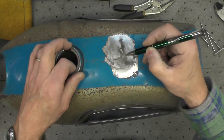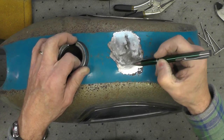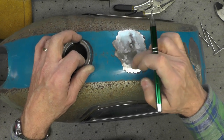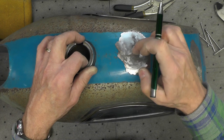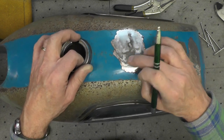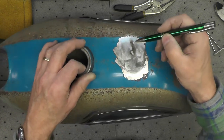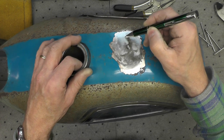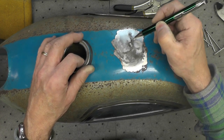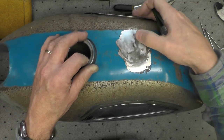Then I'm going to work my way this way, I think you got a little reflection there, because the rest of the dent is in this section here. Put four or five, maybe six nails in this section here and see if I can't get that dent out. But I'm going to finish this one first. Again, I had tacked them in place, lifted or pulled them with a puller, and then came back and just cut them off and ground it smooth.